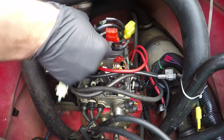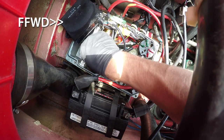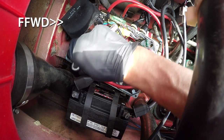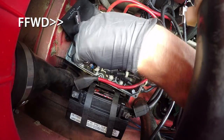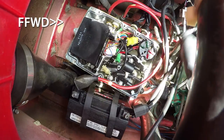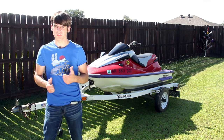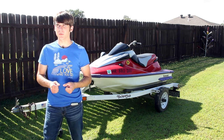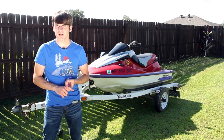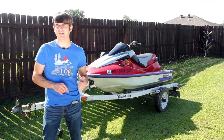So the CDI box is fixed. Here's me putting it back on — I'll speed through this, just me getting it all put together to see if I can get it fired up. After I got this box on, the next thing I did was go to O'Reilly and get a brand new battery for it. I got the premium battery — not the standard $70 battery, but the $112 battery with more cranking amps — because the battery that was on this thing had zero charge after charging it all night and still wouldn't kick over. I had to not only have a charger going on it but also my battery booster box just to get it to crank over, so I knew I needed something with a lot of cranking amps.